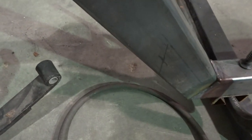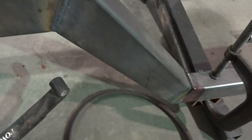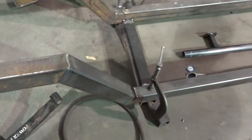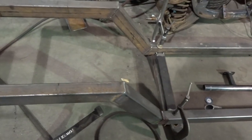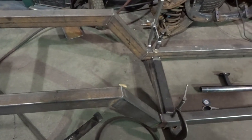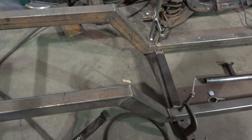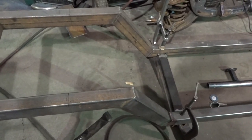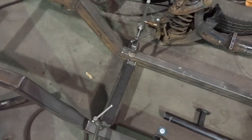It was just way too short for a four-link. The axle centerline to the front of the leaf spring is like 12 inches, so they'd be pretty short four-link bars. Then I'd have to buy coilovers or do some kind of buggy spring. I didn't really want to get too crazy — this car's only purpose is to look cool and do burnouts, which is the opposite of most of the stuff I build.